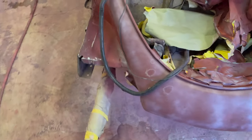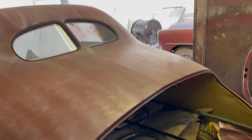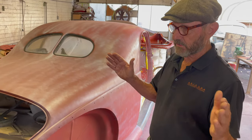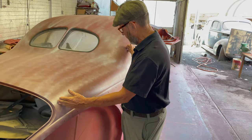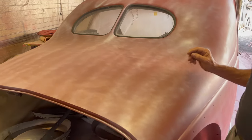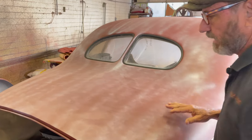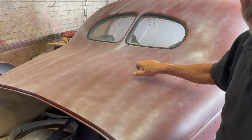He'll take his larger grit sandpapers on a sanding block — we'll use blocks that are two or three feet long. That's one of the secrets to really good body work: use really long, flexible blocks that are two and three feet long. I've even seen them longer than that. When you get into tighter areas, of course, you can't use a giant block. But you have to have a series of them so that you can switch as you go. An area like right here, if you're going to block sand that direction, look how flat that is — that could be a two-foot block.